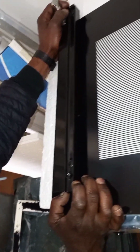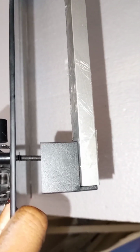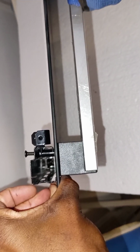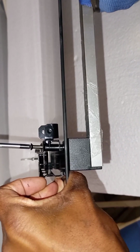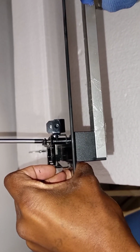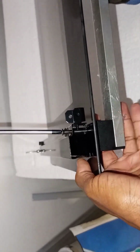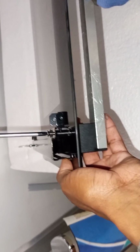So they must take the inside glass, fit it, but it seemed as if they haven't aligned these holes yet. So the screws are now aligned. So what's left is this handle. So we're fitting this outside handle for this oven door before the glass. This screw must go in there and hold it tightly, but not too tight. Remember, this is a glass and the handle is also a plastic, so when you make it too tight you will strip it, and you might cause some damage that will require a new handle.